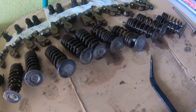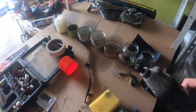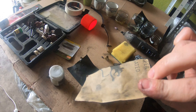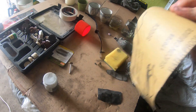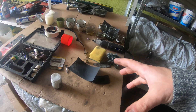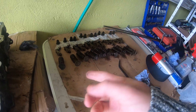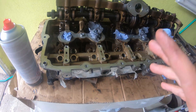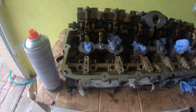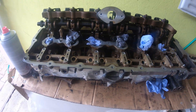All right, so most of the valves cleaned up really well. There's a new one for comparison. What I ended up having to do is actually for the top parts with all the corrosion, I was using a stone on the Dremel to get it all off. Then I used some sandpaper — 120 grit and then 360 grit or 400 grit sandpaper — to sand down the rest of it and get all the crud off. They turned out pretty well. So now I think I'm going to start to lap the valves in here, clean it up once I take the rest apart, and then clean the head completely and be ready for reassembly later. So let's get lapping the valves now.